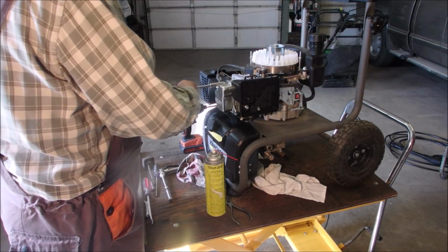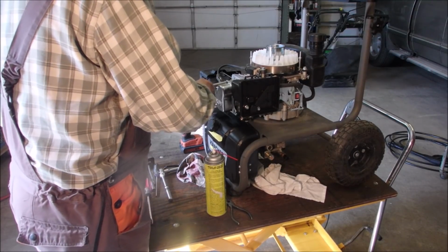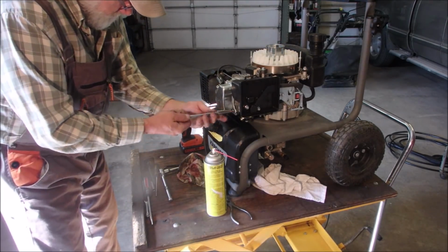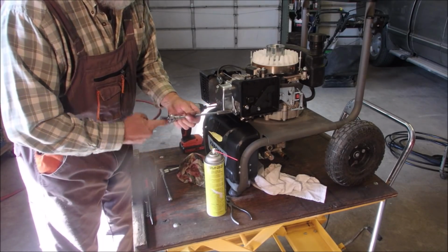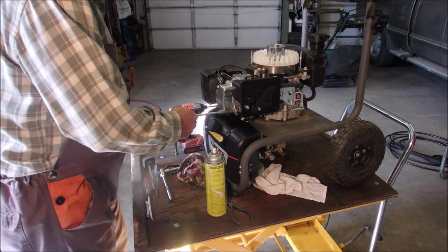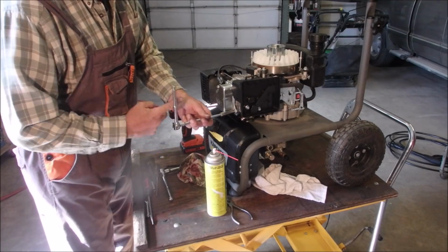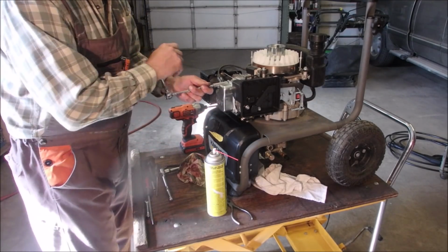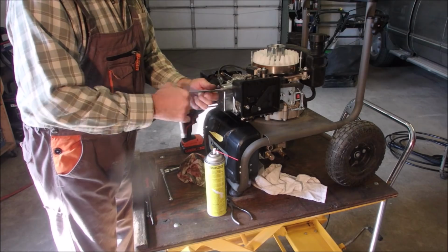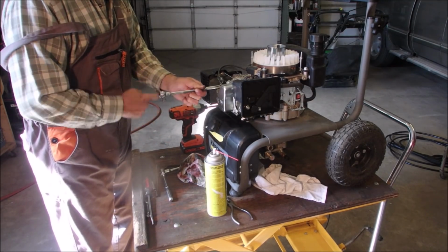So this was a scary repair. There we go. It's like they had Loctite on them in the original install. Excuse me. So why did that intake push rod fall off after 5 hours of use? I can't get an exploded view of this particular motor to see if there's a valve cap on that and it's reaching too far and it's overstressed. I don't know.